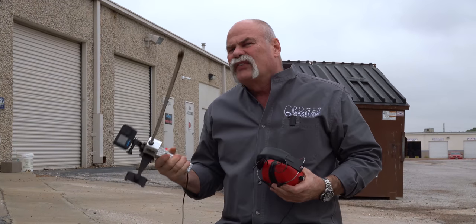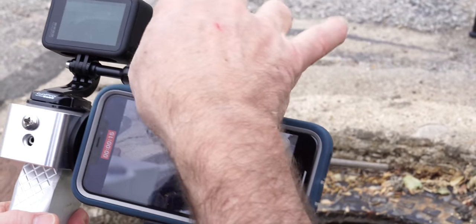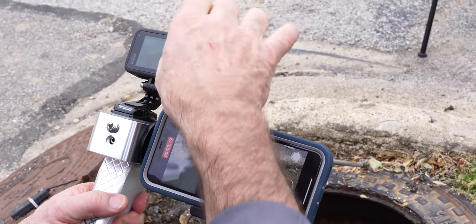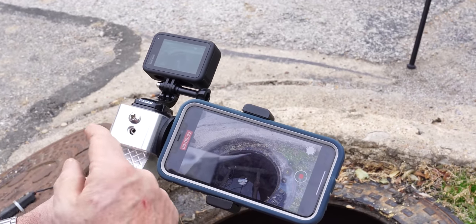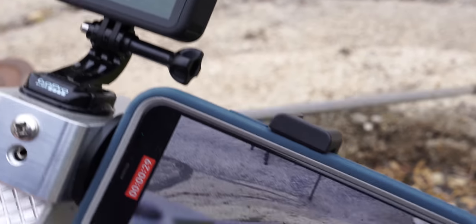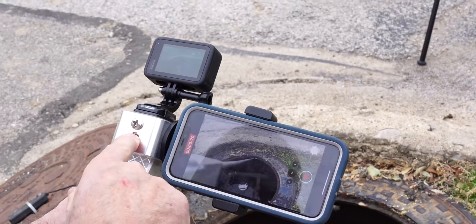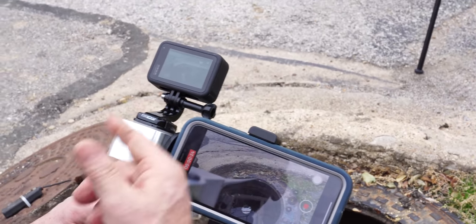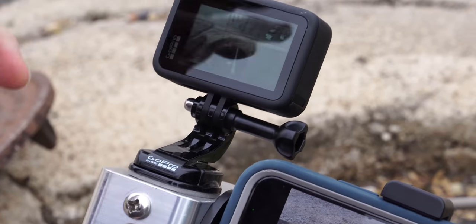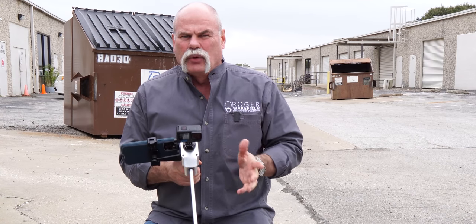I've got the headphones, and this is the Sidekick from Leak Pro. I've got my GoPro set up where I can see the probe right down at the end, and I've got my iPhone set up the exact same way. I do this for two reasons: I've got special wires where I can plug a microphone into my GoPro, take a splitter out of my Leak Pro, go into my GoPro, and into my headset. So when I'm videoing, I actually get the audio. If I want to do a presentation for the customer, I can plug in a wireless microphone adapter to communicate the entire time. I can show the customer exactly where we were when we heard the noise, and let them hear the exact same noises that we heard.